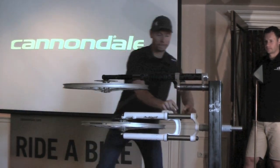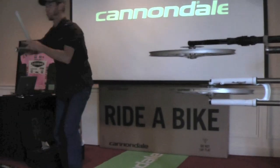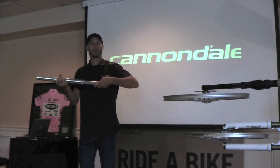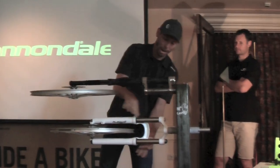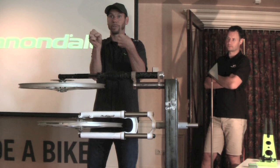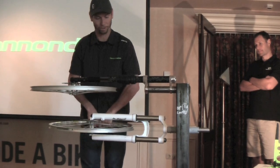That's how they work, because these are round and round. Here we have square and square. The square tube inside, square scoop on the outside. We've got the needle bearings around. It's in here, you cannot turn them because there's flat and flat. Here we have round and round. And then we use this bridge, this, and this to try to avoid that they twist against each other. And this is what we're demonstrating right here.